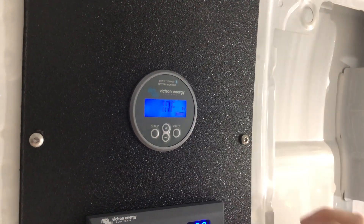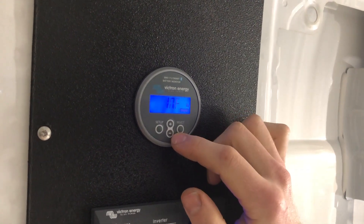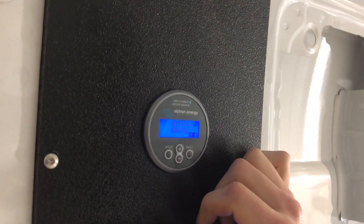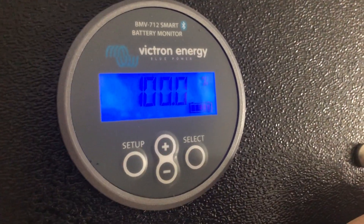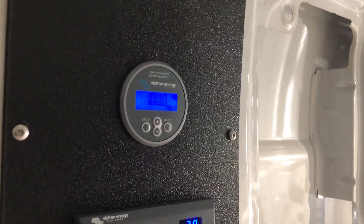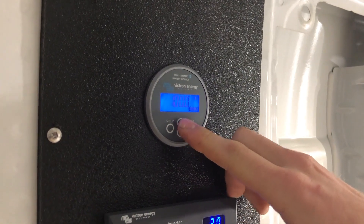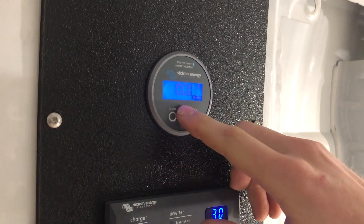If you were on just battery power with quite a bit going on, it might say something like eight hours — you can continue to run your loads for eight hours before reaching your 20% mark. With an air conditioner it might say two hours. The next screen — what most people look at — is the state of charge, like on your smartphone. We're at 100% right now. This is calibrated, but it may not be fully accurate yet since there's still charging current coming in from shore power. It'll get accurate after you've used the batteries for a bit. It goes down in 1% increments: 99, 98, and so on.